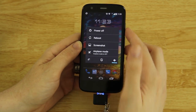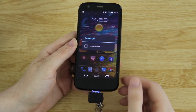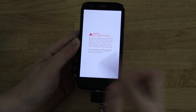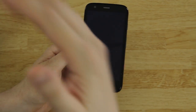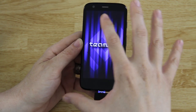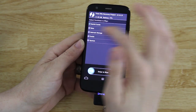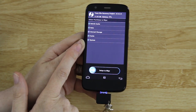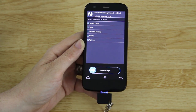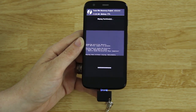I showed you how to power the device off, hold Volume Down and Power, then let go of power to get to recovery. You can also use Recovery Tools with the rebooter option, or Titanium Backup's menu, or a simple app called QuickBoot where you place a shortcut on your home screen. There are tons of ways. Now we need to go to Wipe, then Advanced Wipe. We need to choose Dalvik, Data, Cache, and System — those four options. Normally I would also choose internal storage to have all 16 gigs available after flashing, but since USB OTG isn't working right now I cannot do that. Swipe to wipe — this will take just a second.